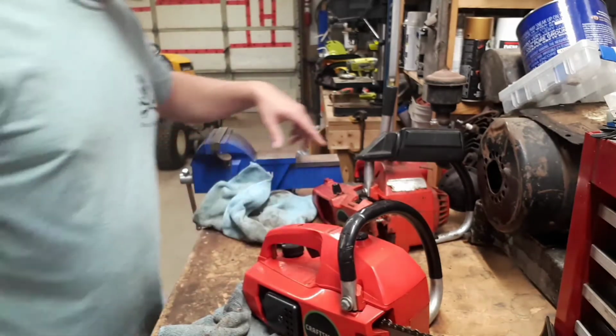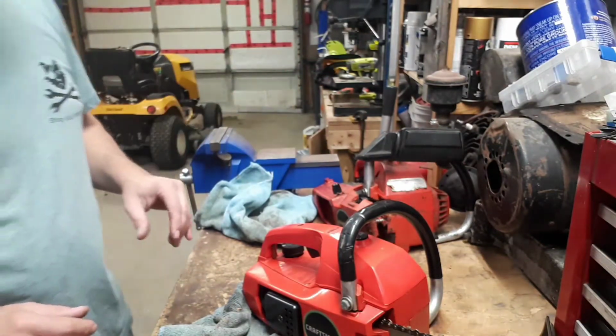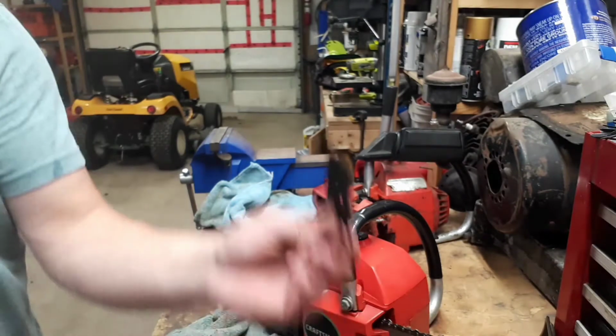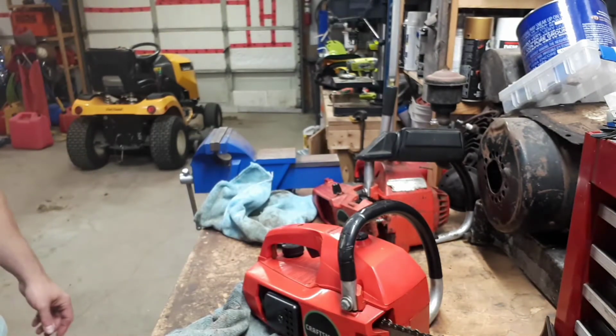This other one has scratched in on it 20 to 1 mix, which is still pretty oily. Everyone I've talked to suggests maybe something more like 40 to 1. So I'm going to run that at least, and without the spark arrestor, to see if it cleans up a little bit. It just seems to really kind of choke out, plug itself up on oil.